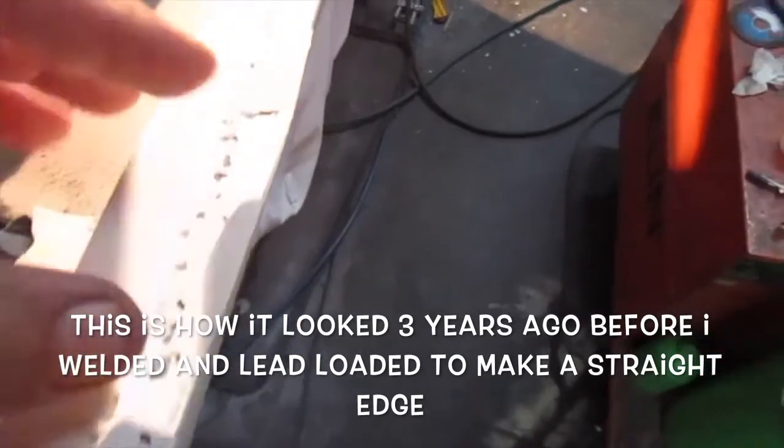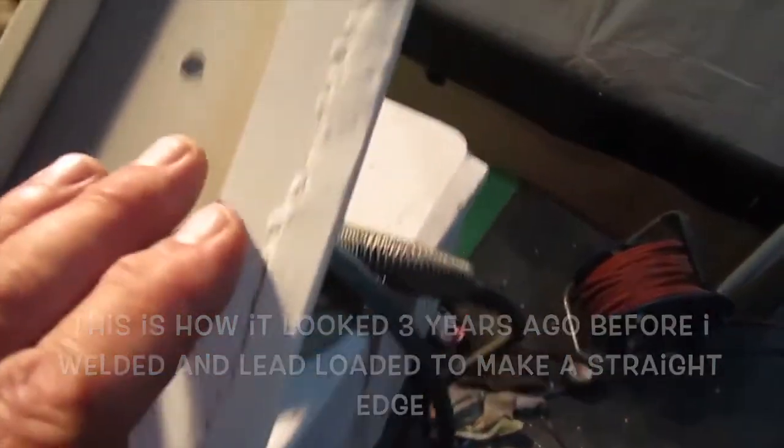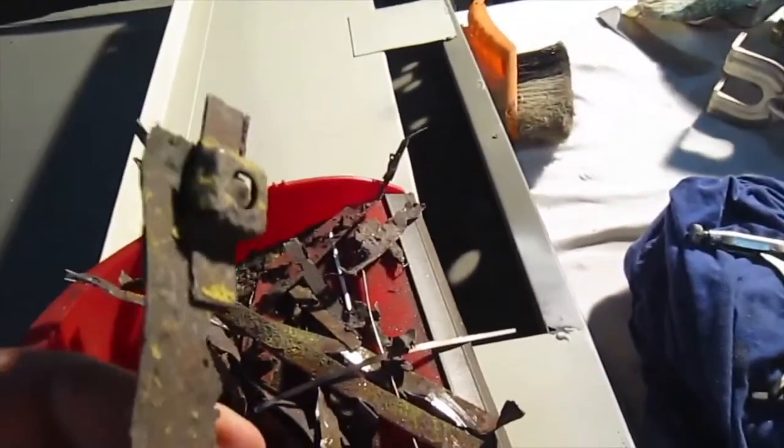You can see here — it doesn't look great, but a lot of this was lead loaded before and it was quite badly corroded. I've taken all the corroded bits out, just tacked it all the way up, put a brand new strip in the side here, and then tacked it all the way up. The other side's done. I also built a new piece in here — you can see how rotten it was, and the front has to be repaired as well. These are some of the bits I took out — you can see I had to be very, very careful with it. These are the original captive bolts and you can see how bad they were. All these pieces were welded or tacked on to the underneath of there — I had to take it off a little bit at a time.